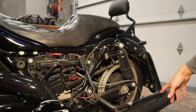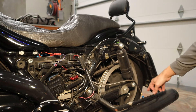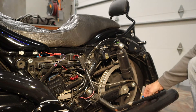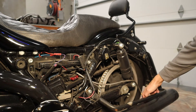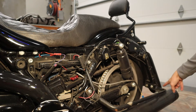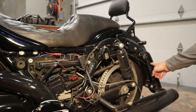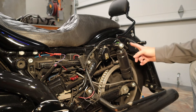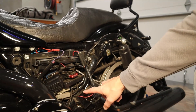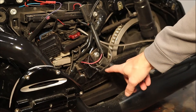So I pounded out the baffles out of here and got them out of the way, and I drilled some holes in there and then just welded them in from the inside. Well, this one I didn't have to because that one just screwed right in. That one had to — no big deal. And then ran their spark plug wires that run up through here down to your module, which is right down here if you guys could see that, the actual module.